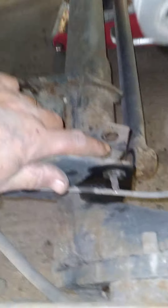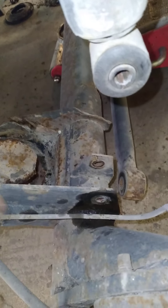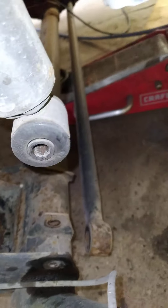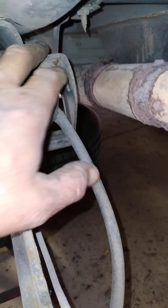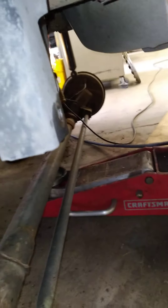When you go around to the other side, same location — 15 millimeter. Don't worry about your metal brake lines because they're soft rubber from this point forward to a certain point, so when you lower your floor jack to lower the rear end you don't have to worry about kinking your brake lines.